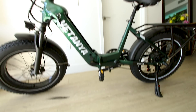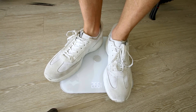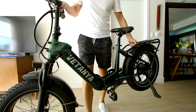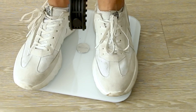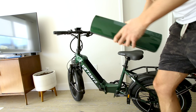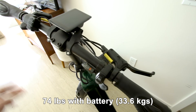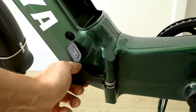Use a 15-millimeter wrench to bolt the front wheel down. Front fender on, headlight on. Let's see how much this thing weighs — I'm 199.2 pounds. Picking up the bike without the battery and stepping on the scale gives me 261 pounds, so that's about 63 pounds without the battery and about 12 more once you pop that battery in. But let's not pop it in yet — if you're going to fold this thing up, you want to keep that weight down.